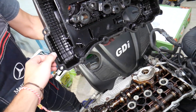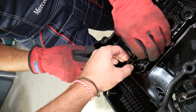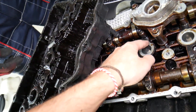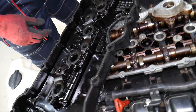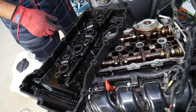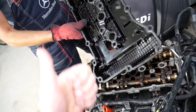When you remove the valve cover, always replace the valve cover gasket. This gasket also includes a section around the spark plug holes. If the valve cover gasket fails around the spark plugs, you'll end up with engine oil in the spark plug wells. We'll have a video on our channel about torque specs for the valve cover — you must use the correct torque specs, otherwise you can break a bolt and destroy your cylinder head. Hopefully this video will be helpful. Thank you for watching and see you next time.